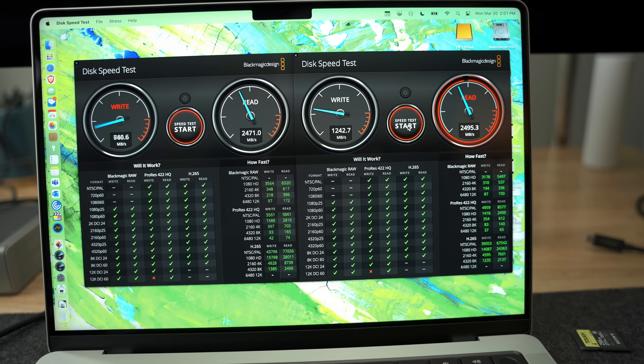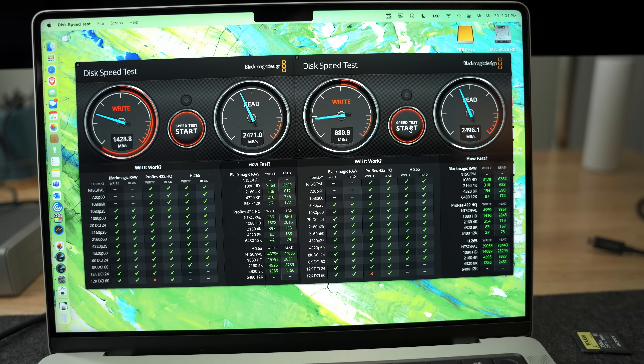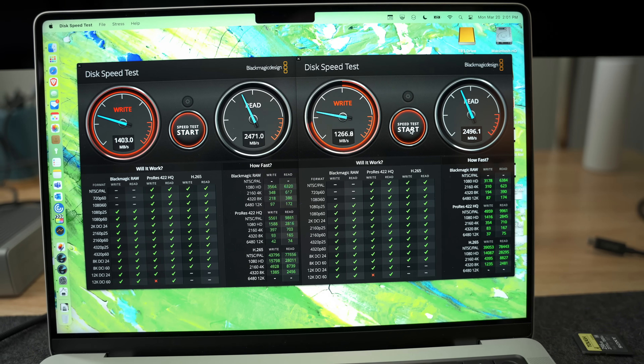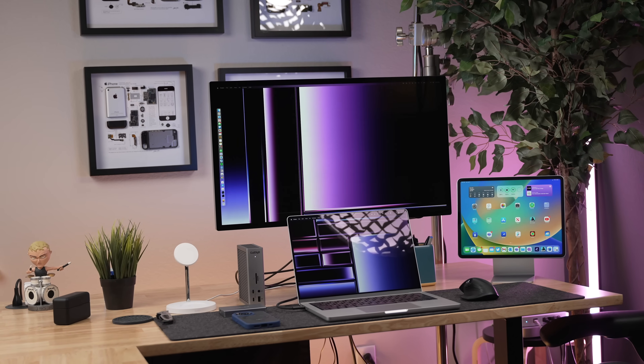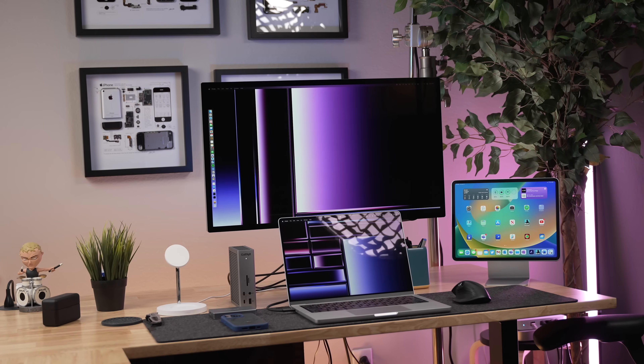You can actually connect two external SSDs and still get a very similar speed on both drives at the same time. When you have a display connected, you might see a drop off of the max Thunderbolt speed because displays will always take priority over data.